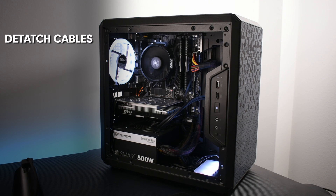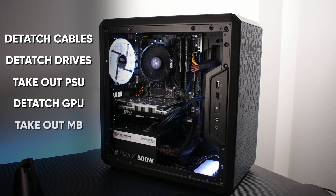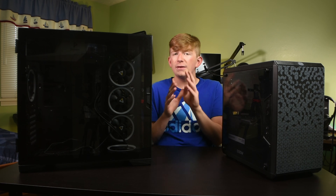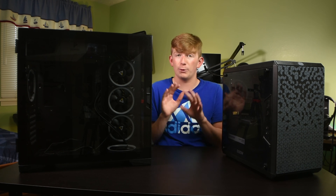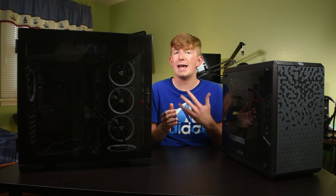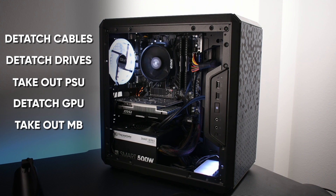At the end of the day, it really just comes down to detaching cables, taking out all of your drives or SSDs, then once you have everything all disconnected, take out your power supply and then install that into your second case. Next, you're going to detach the GPU, take out the motherboard with the RAM and CPU still installed. If you want to, you can disconnect your CPU cooler, but this is an optional step — certain people with liquid coolers definitely have to remove theirs, while others with stock coolers from AMD or Intel can probably keep theirs on. And then after all that is done, you're also going to want to transfer any fans and RGB accessories.